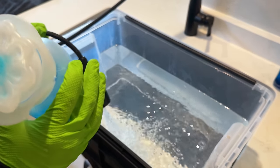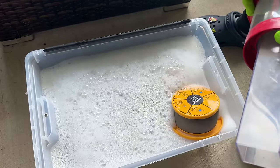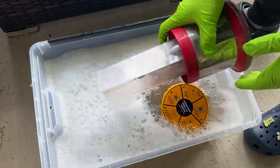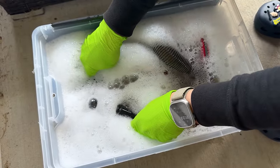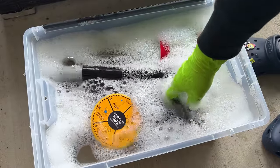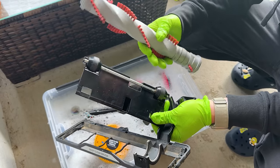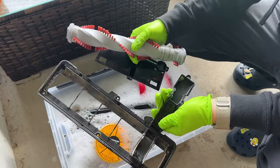I'm filling up a container with some warm water and adding a squirt of Dawn dish soap. This is what we're going to soak all of those dirty parts in to remove any remaining dirt. I like to use a container this size because some of the parts are oblong and weird shapes and this fits them nicely. There are just a few things I won't soak in the water, like the roller brush or the little wheel tray, because there are bearings in there that I don't want to get wet. I'll just wipe those down with a damp cloth.